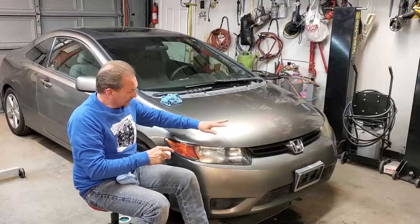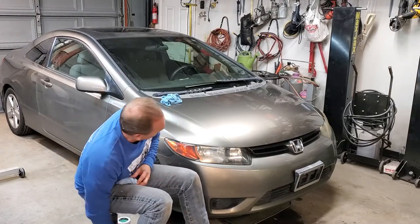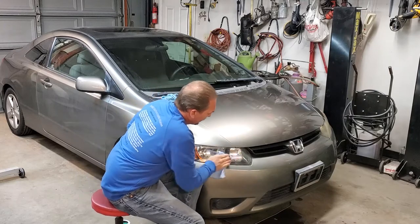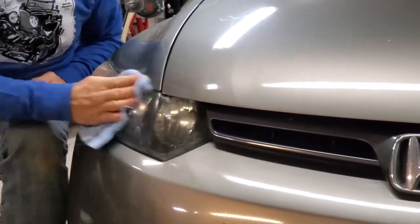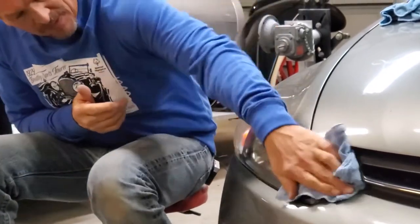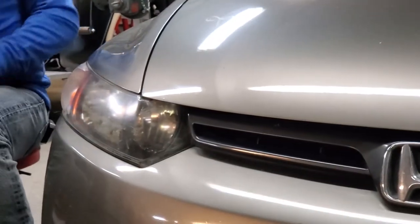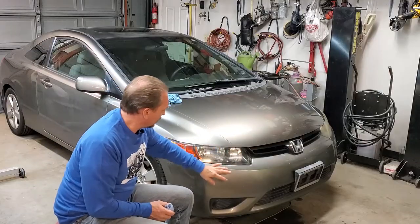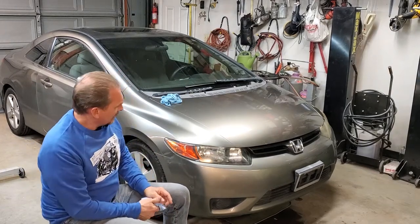So for the next two minutes, just leave it be — grab a refreshing water or something — and then come back and you're going to buff it off with the blue terry cloth towel. By the way, you can wash these towels just like any normal rags and they're fine for reuse. Now I'm just going to buff this stuff off. Compared to where we started, it's fantastic. Compared to what it looks like on the Solstice, it's not as perfect — as I keep saying, this headlight is definitely broken with stuff inside I can't clean off. But you can see the outside cleaned up real easy.